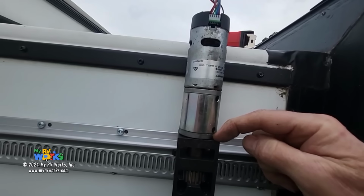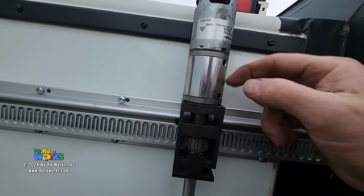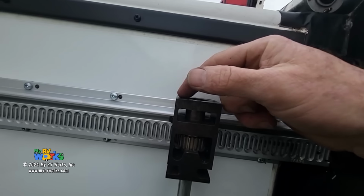I want you to lubricate at the base of this motor right here. So remember I said pull the wiper seal back and get your drive shaft? Well, I want you to pull your wiper seal back and get the base of this motor. And that product will wick itself down in here and work its way inside that collet, where that steel collet is rubbing against the aluminum bearing block.